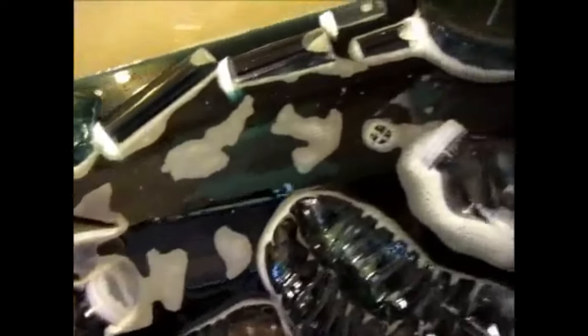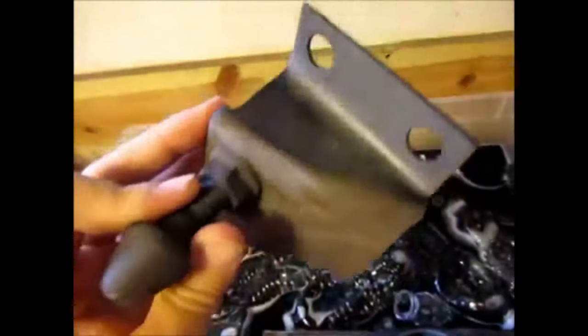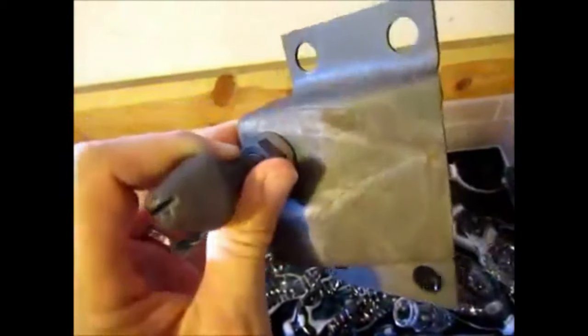I'm going to leave them in here for maybe a couple of days to make sure the hinges are clean and free of rust. I noticed there's a coating — maybe the E-coating or original paint from 1974 when these hinges were built — and the phosphoric acid is stripping that as well. I left this other piece in for a week and it's completely stripped of all the E-coating, so the same thing will happen to my hood hinges.